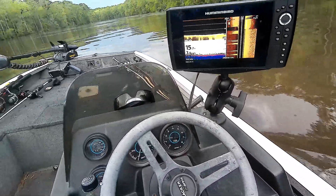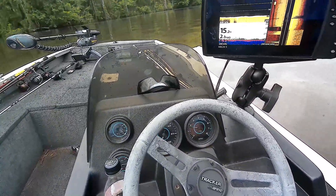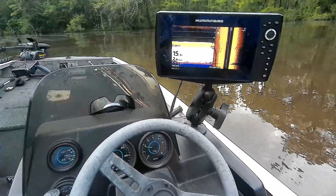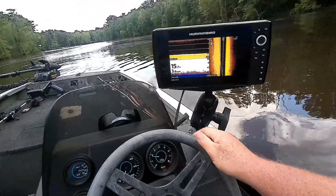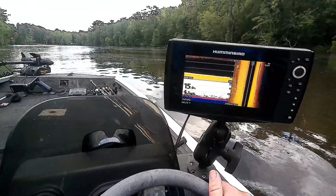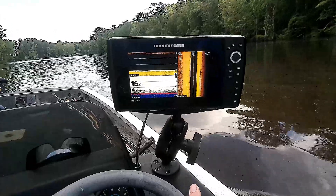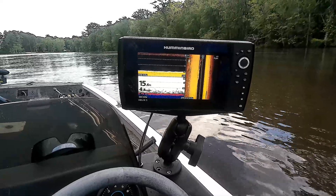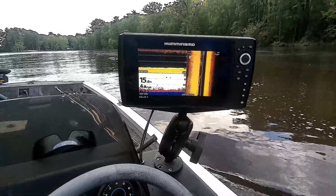That's not exactly what I was hoping for. This is actually very similar to how the 10-pitch prop was, RPM-wise, and maybe a mile or two — maybe even a hair slower than that. The only thing I can think is the extra weight of the stainless prop, otherwise it doesn't really make sense. It should be somewhere in the middle between the 10 and the 8. Frustrating. I guess the one thing left to try is an aluminum nine-pitch prop and see what that does.